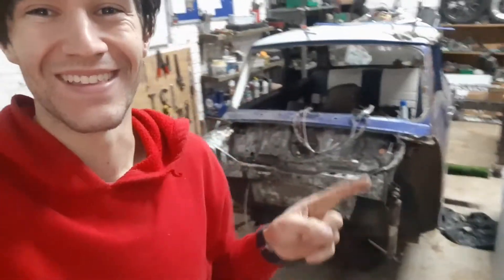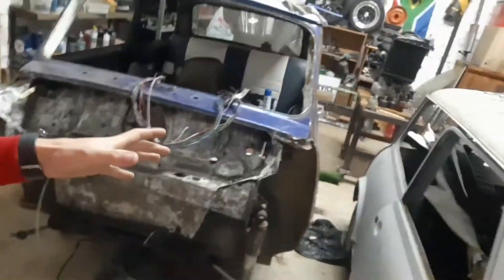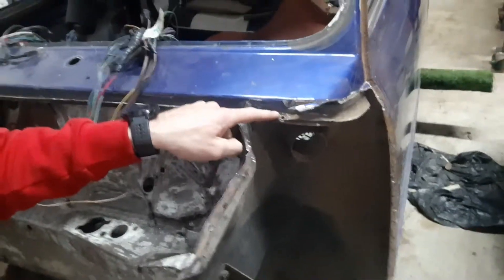Hey guys, welcome back to the channel. It's been a day since the last time lapse you saw. Going to basically close it up today — did a really good job, first time chopping it, it was a lot of fun actually, super satisfying. I need to clean up in the corners and where I drilled out all of these. I'm just going to use my MIG welder and tack, tack, tack, then grind and clean it up in the corners. And basically that's it — just need to wait for the fiberglass front end, and I'll show you how to install braces and all of that to the subframe.